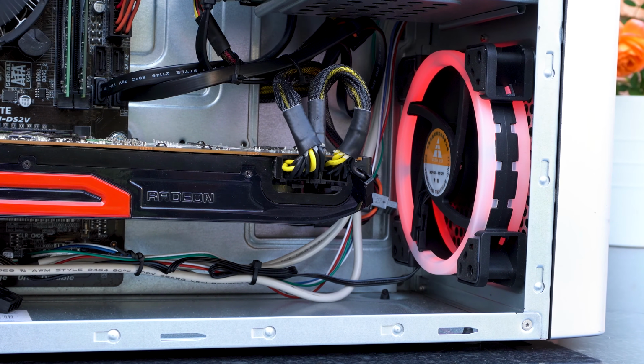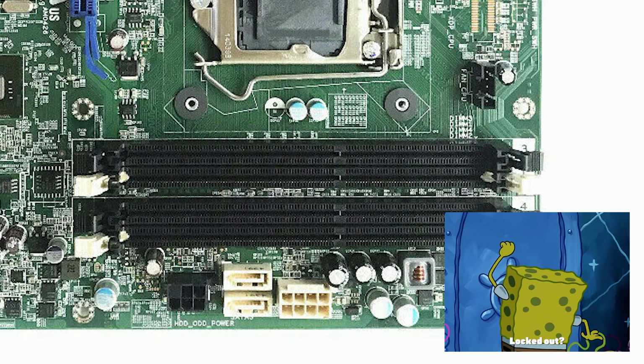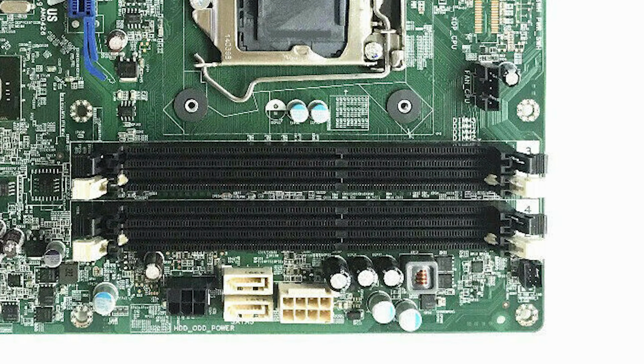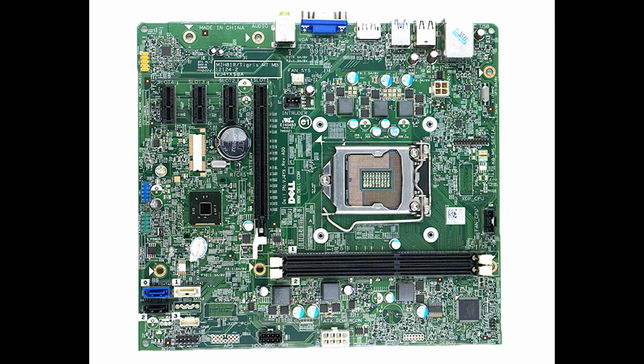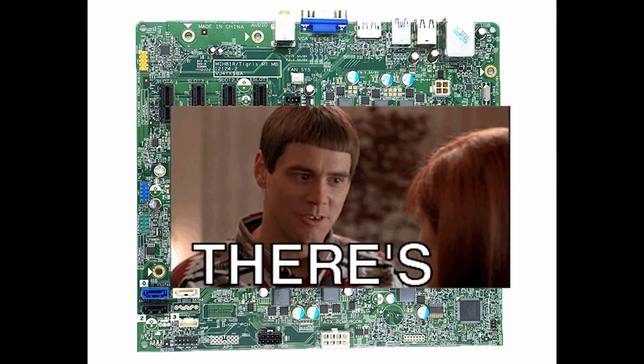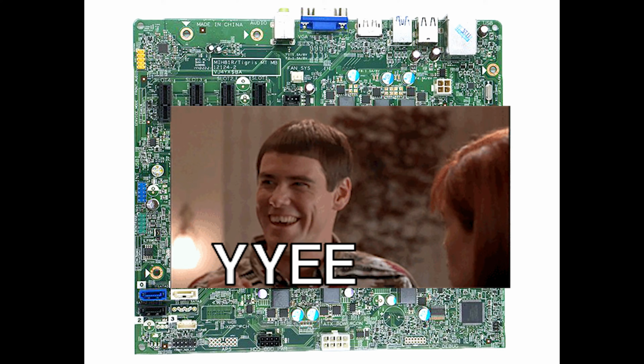You could find yourself dealing with non-standard motherboard connections, plus you're stuck dealing with a lockdown BIOS. I've personally had issues with Optiplex machines refusing to recognise certain sticks of RAM. It's also a bit of a lottery whether they'll recognise the CPU or GPU you'd like to use. So for this reason, I decided to try and avoid an Optiplex and instead opt for something else.